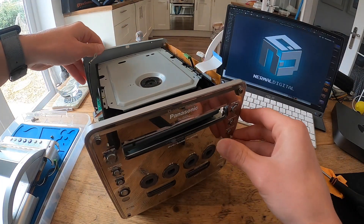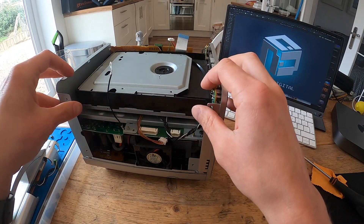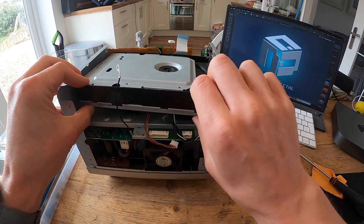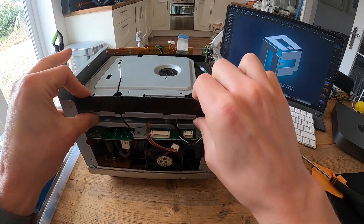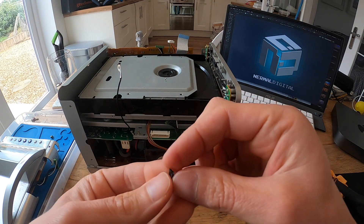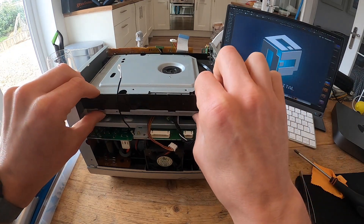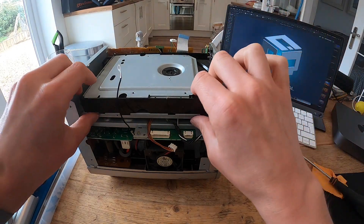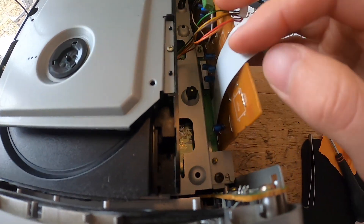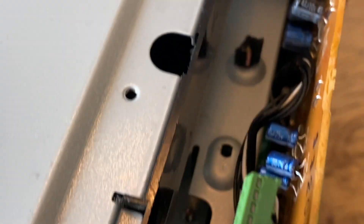I've gone as far as I'm going to go today, because as far as I know it's just the DVD drive that's out of alignment. I can see that basically the pillars that support where the drive sits have completely broken away. That's what all these plastic bits and screws are from. Here's one of the broken pillars right here. They're completely broken, which is why it's collapsed on itself. The reason why it's raised up is that those guys are still half there on the other side. We can still see the remnants of the pillars — one bit of pillar there, and a bit there. And on that one you can see the exposed screw itself.